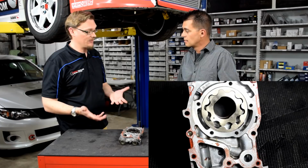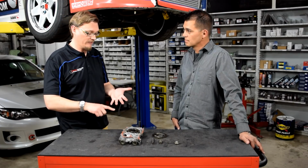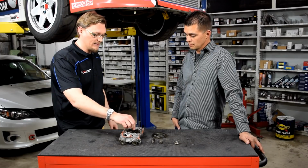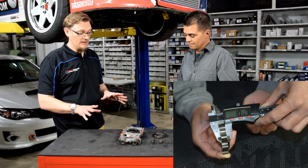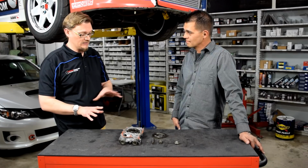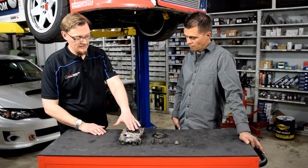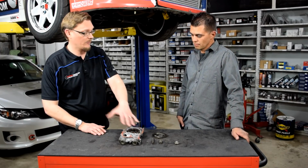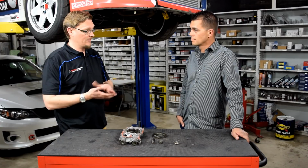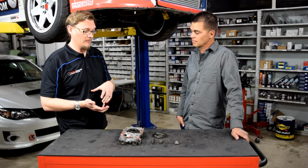One is, when you're talking about different pumps, so we've done another video, the 10mm pump, 11mm, 12mm, that is the thickness of this rotor. That's what they're talking about is the difference. So in the simplest sense of it, this rotor, if it's 10mm, that's the height of this column of oil. If 11mm, that's the height of that column of oil. So the larger the rotor, the thicker the rotor, the larger the volume of the pump, or the larger the volume the pump can move.